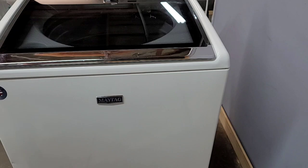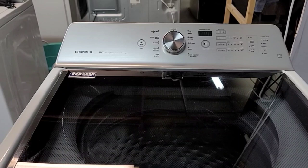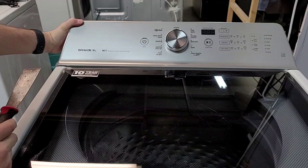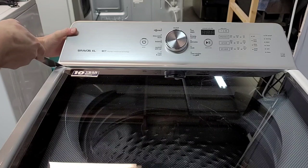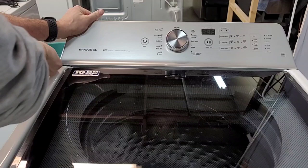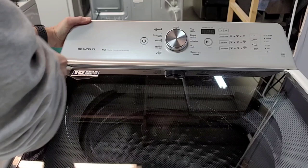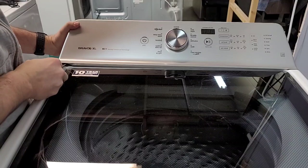Now this is where we're going to take our flat scraper tool and pull this up right on the side here. You're going to pull forward and push back — give yourself a little wiggle room. Just be real careful. If you can maybe find one that's a little thinner — even a butter knife would work. You're going to slip it down in here without scratching up this stainless steel plating. Kind of wiggle it under there and push back on it. Once you've got it in there, it goes back quite a little ways. There — I'm on the clip. Now you can just push it and this side pops up. Now that side's free.